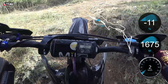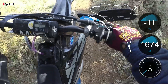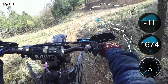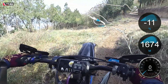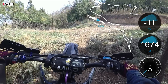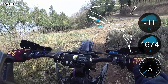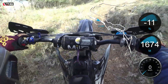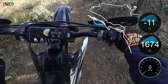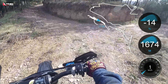The lowest RPM remains at 1200. It seems to be an almost unbreakable RPM threshold. However, the torque performance is already remarkable. The bottom end torque is very compact, and I can confidently tell you, in this aspect, it's definitely better than the Smart Carb S2. I can clearly feel the difference. In this regard, the XTNG Gene 3 Plus 36 and Billitron Pro perform identically. The Gene 3 Plus 36 can also effortlessly drop the RPM to 1200.